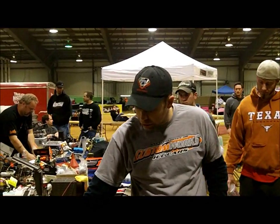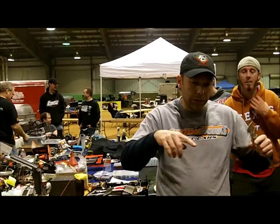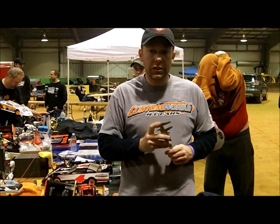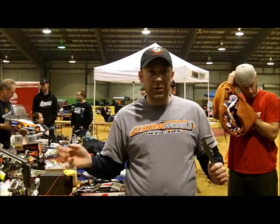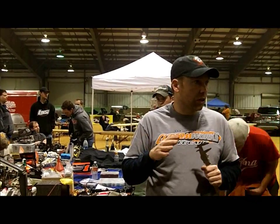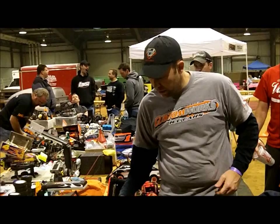A sprint car, you kind of measure right up to the neck, and right back here. The newer Pro-Comp chassis, there's a little teardrop on the back corners, so you can actually get to it with this. So you're not trying to slide a little block and you get some dirt on your table, and the next thing you know, your block's up half a millimeter if you hit them. But that's an easy way to infallibly make sure that you're starting somewhere in the middle of the ballpark. You're not biased one way or the other.